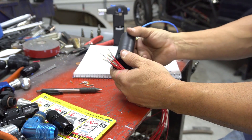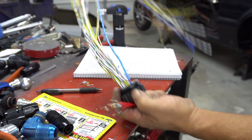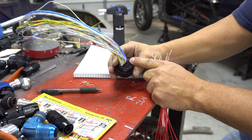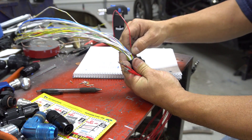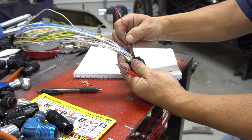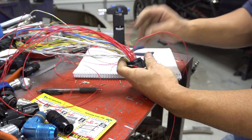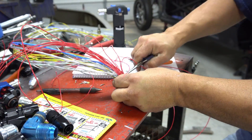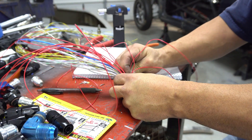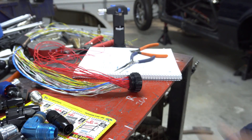To work with these connectors, this is just a piece of shrink tube and it unscrews from the back like so. We pull that back out of the way, and this connector is labeled down inside of here. We're going to start at pin 27 on this side and just plug these red wires in — they've got to go all the way in until they snap in place. There's the 16 power wires, ready to be installed in the car now.